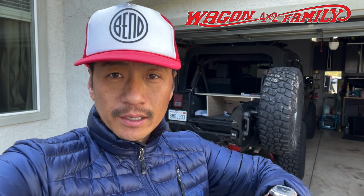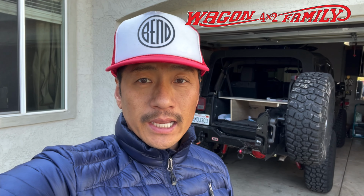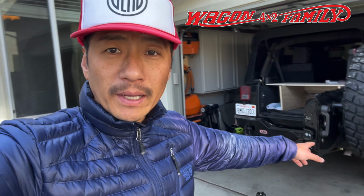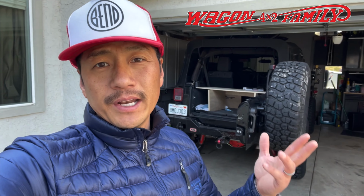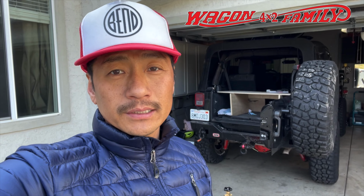So I drove the rest of the way down the hill to Slide Park, turn off the Safeway. I drove maybe 15 some miles, just took it slow. Then I got to the Safeway parking lot and pulled the stabilizer apart and bent it back with my sledgehammer. I used parts of my Jeep as leverage to bend it back straight. Then I got it attached and I was off and running. So not too big of a deal, but just FYI, if you bend your steering stabilizer on a trail, take it off, bend it back and put it back on, because that death wobble is no joke.